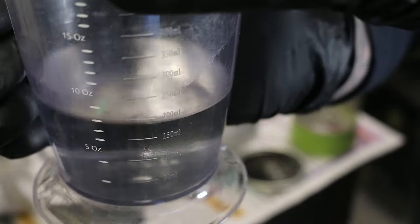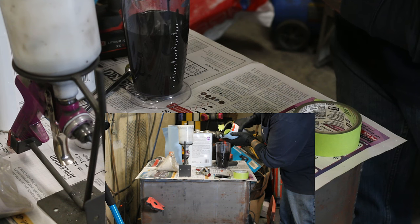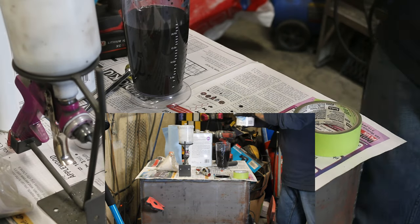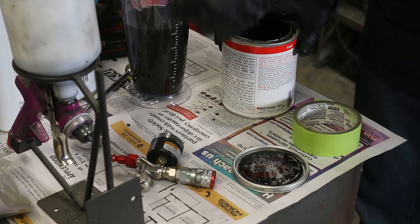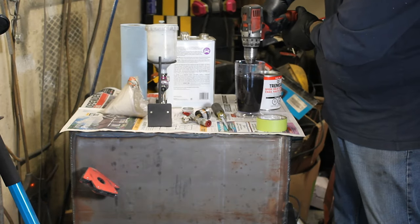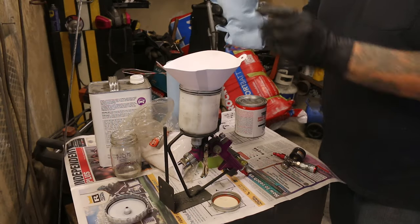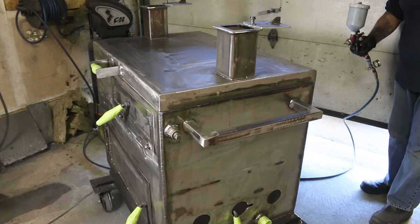In this instance, I used 200 mils of acetone and 400 mils of paint. And no spills, no waste. Stir well before using a paint strainer to add it to the spray gun. We use a 190-micron strainer, and then it's paint time.